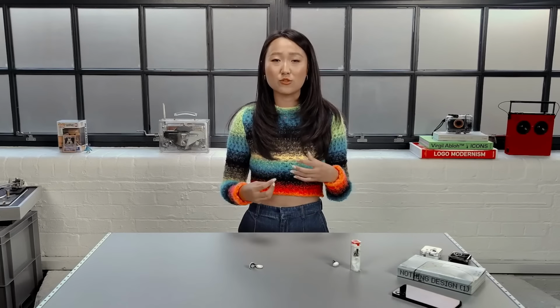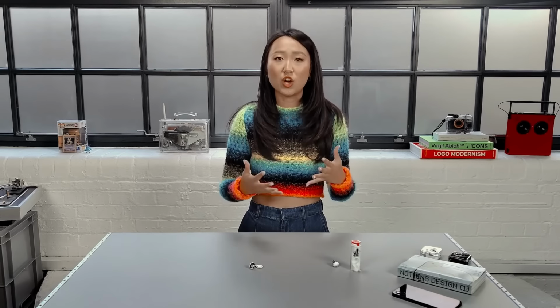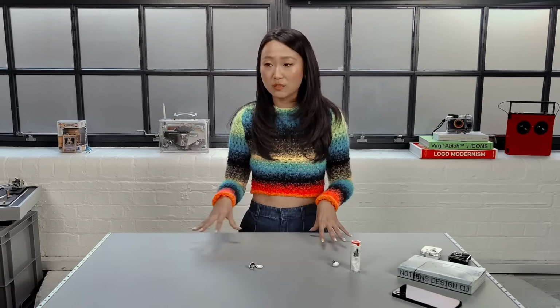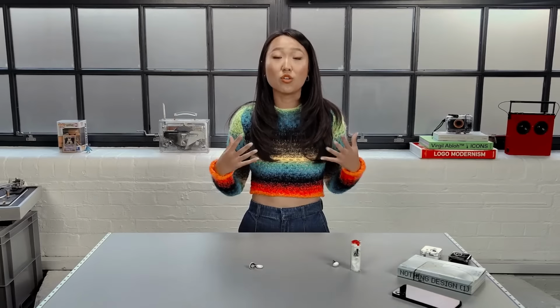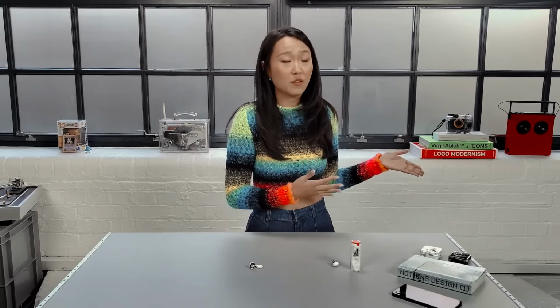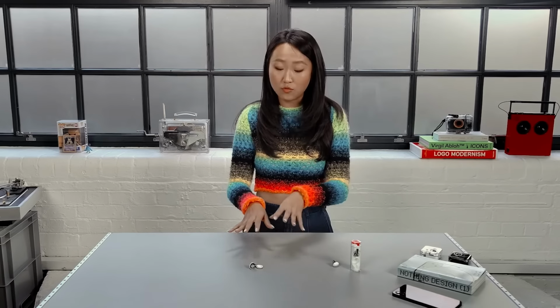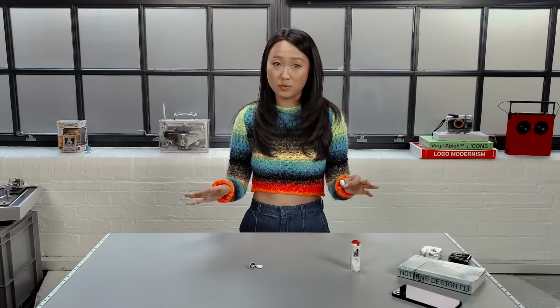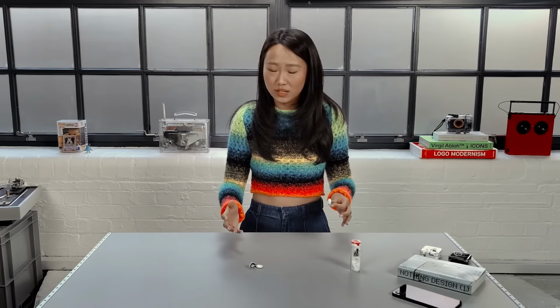For Ear Stick, because it's naturally half in-ear, we wanted to go with a bigger driver to compensate for the fact that it's half in-ear. And that's because bigger drivers usually means better sound quality as it produces stronger waves. But some of the bigger drivers, especially the off-the-shelf stuff other brands use, make the overall earbuds bigger and heavier and therefore less comfortable. So that just doesn't work for what we're trying to do here. So we decided to customize our own.